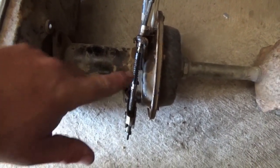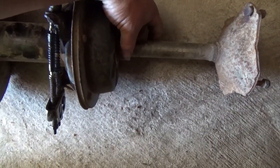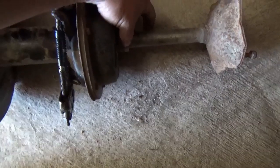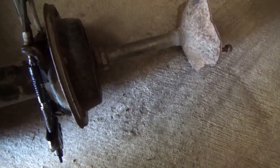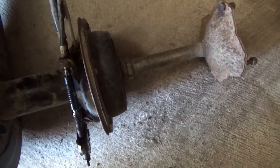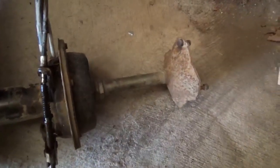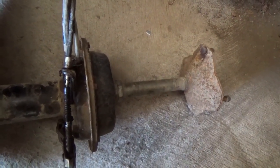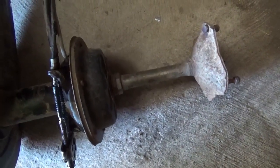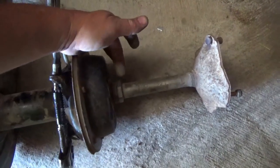To change the bearings, you have to take these 2 large nuts off the axle. So you've got to hold the axle still and remove them. Some people get these loose first. They spray them, and while the axle's still on the bike and the tires are still on, they put their long wrench on it and jump up and down and utter blue words and get them off that way. I've had some success with that. Generally speaking, for me, they seem to like to round out.